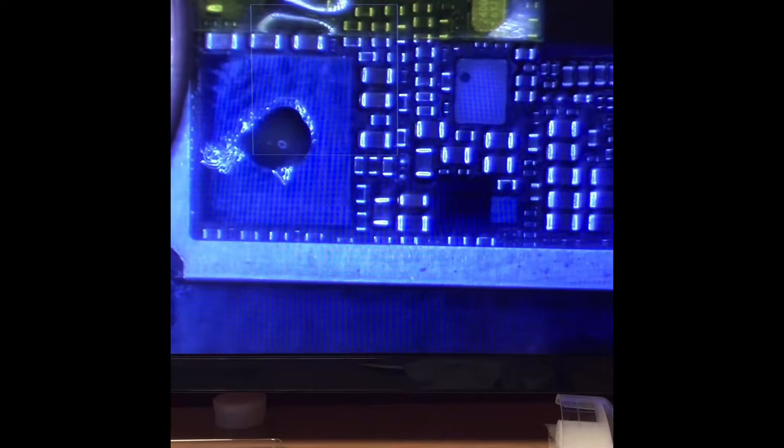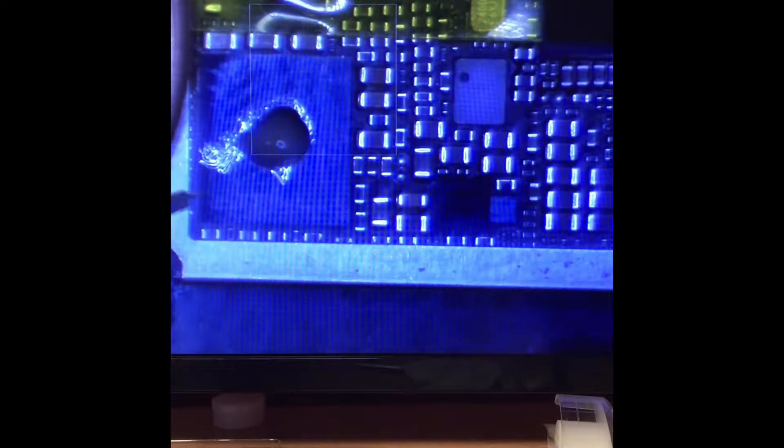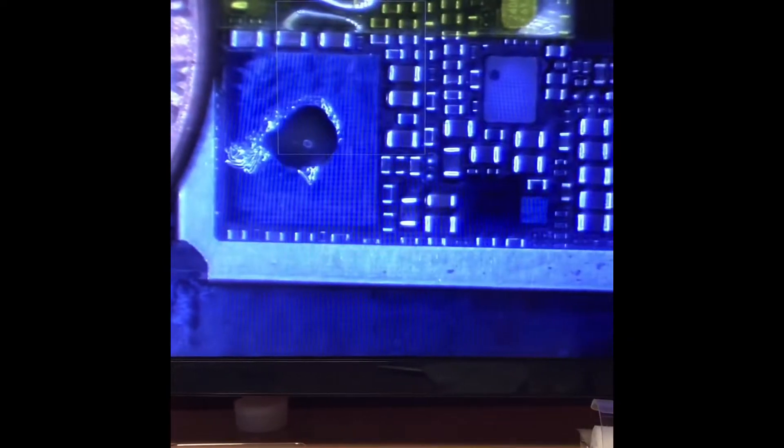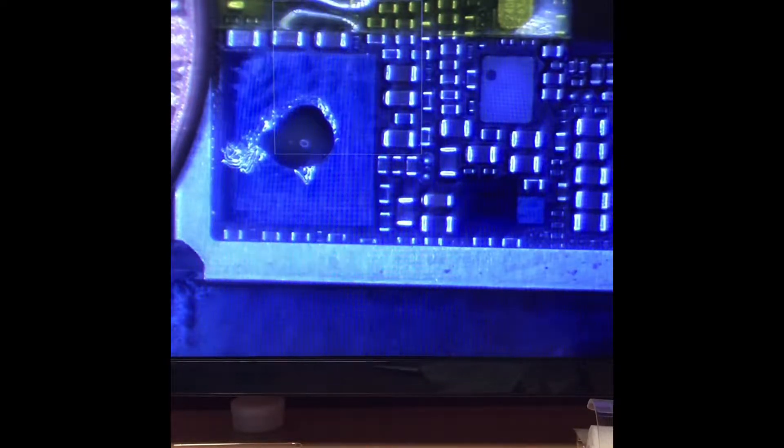So this is the iPhone 7 Plus. I'm going to replace the audio chip and do the jumper, because that's going to be the problem. I'll post the video after I do the jumper too. For this one, you guys need to use at least 400 degrees temperature and airflow like 45 or 50, because this chip is very tough.